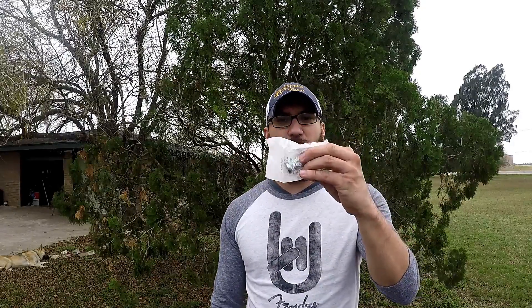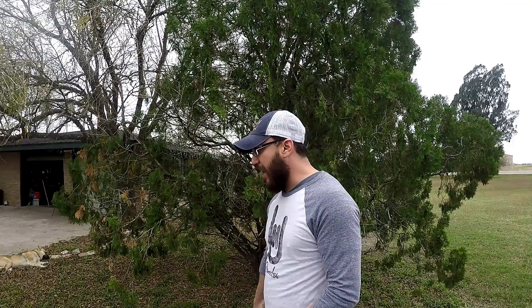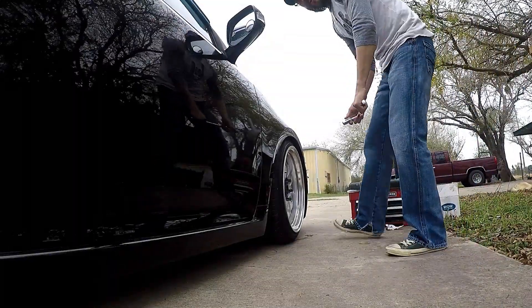So what you're going to need: your new studs - these are a 12 by 1.50, you can pick them up at any auto parts store. If you're really particular about it, you can go to the OEM Scion Toyota dealer, but you're going to pay a lot more. You're going to need a hammer to knock those suckers out, your jack, and standard tools. I'm a guy who wears gloves - don't want to get your fingers too greasy.